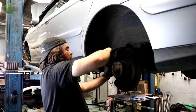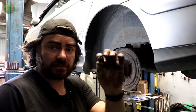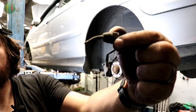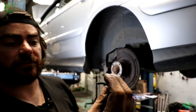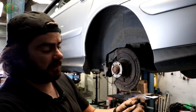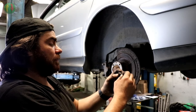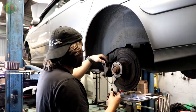Right, she's playing ball. So what I've got to help me with this is an old offcut of brake pipe. That will be off a TVR somewhere. That's a bit of copper pipe, goodness actually, looks like, and just an old union. And that would have gone up to, judging by the bend that's in it, one of the front brake pipes on a Chimera. What I'll do with that is I'll undo this union and screw it into this one, provided they are the same size.